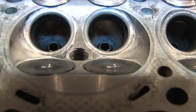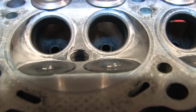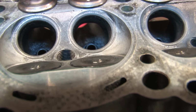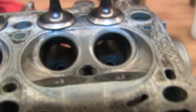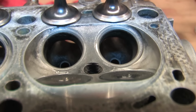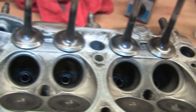These things look much better than I ever thought they would. I'm eating my words right now from what I said in the 104 video, but really I'm glad. It's a whole new set of valves, plus $20 to $30 to replace each valve seat, depending on who you know. You can't do that yourself. It requires precision boring equipment to remove the seats, and an industrial oven and liquid nitrogen to install the new ones. It's an expense I'd be willing to make on a head that I have this much time and money invested in already, but I'm glad I don't have to.